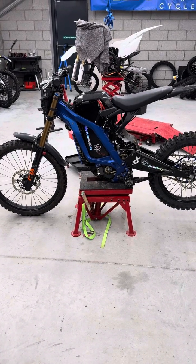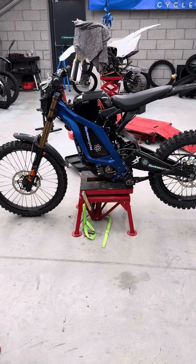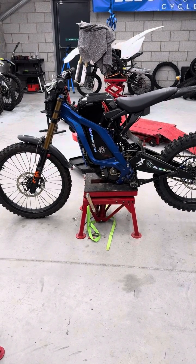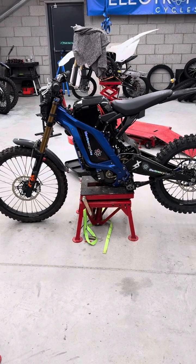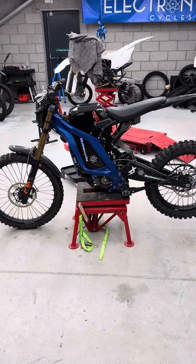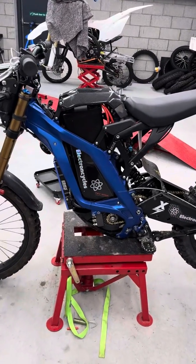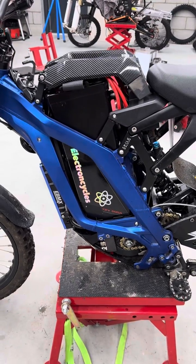So here's our WORX test bike. We've just done a massive battery upgrade. We've got twin parallel six AWG cables coming out with QS8 connectors, but we have a fully monitored discharge of 300 amps, which includes heat and cell balance. So we really massively modified the battery — it's a little bit of a secret how we've done it, because otherwise we'll get copied again.